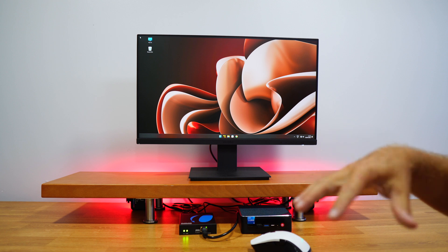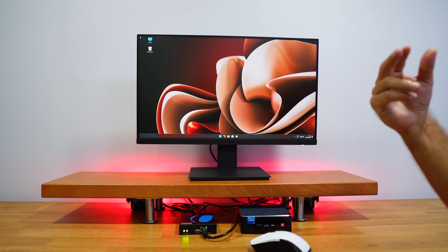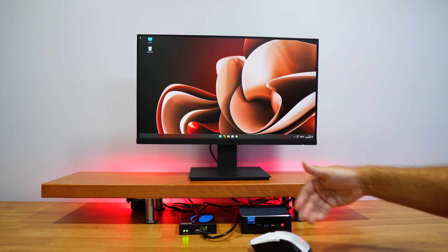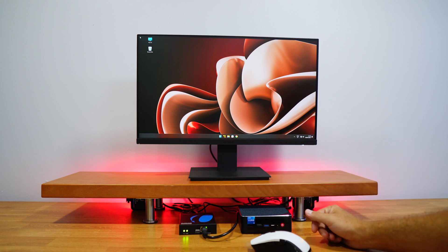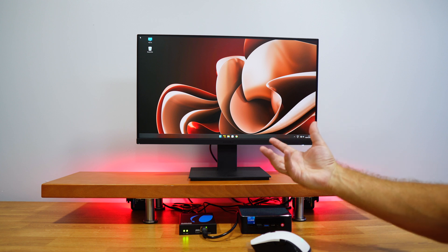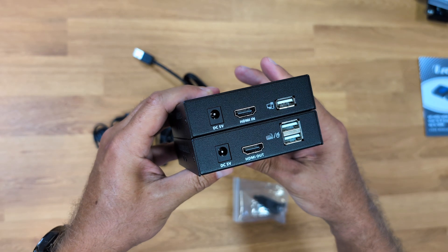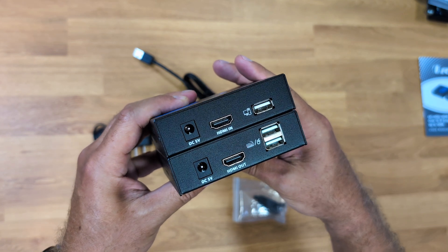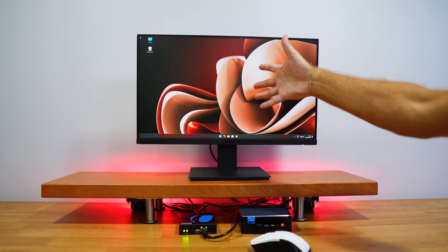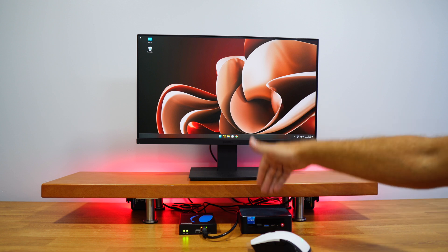In this case, the transmitter is connected to a switch, and from that switch I have several cables on the network including internet connection and those two workstations — actually just the display, keyboard, and mouse — plus the KVM HDMI device from Ouri, which makes the magic happen. On the receiver side, I just need to connect one cable from the switch, one HDMI cable out to the display, and a keyboard and mouse to control the main computer. That's it in terms of connectivity.